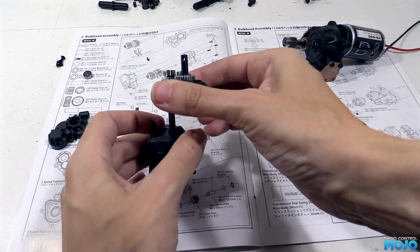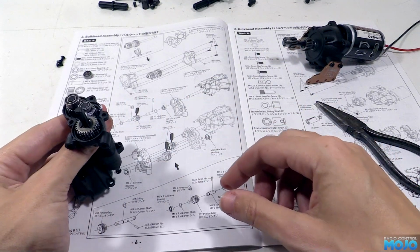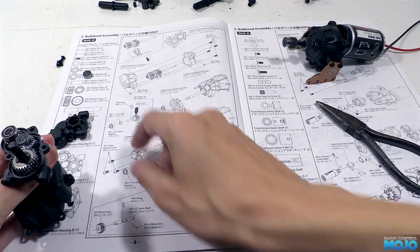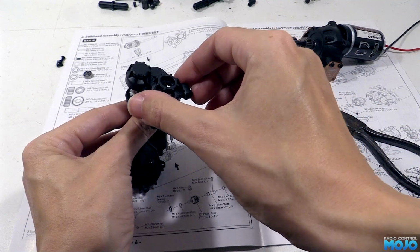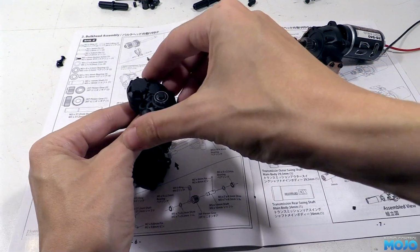There's no point in really packing it with white ceramic grease. Now if you go marine grease, packing the gears is quite common to keep the water out. It does add a lot of drag though, and I'm not sure how the 2-speed would like it. But hey, it's a truck, not a submarine.